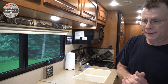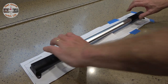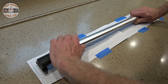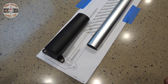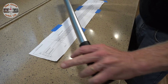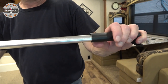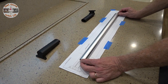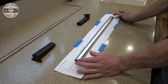After getting our marks on the door, we carried it over. We had one side of the template taped down, and as I came over with it, I put it down on the taped side and Cheryl lined up the other side. The whole purpose behind the template is to make sure when the bar is mounted, it goes past Line A. If you don't put it in far enough, it's going to eventually break. If it goes past those lines, it's a nice solid fit. Just make sure it's past Line A on both sides and you should be golden.